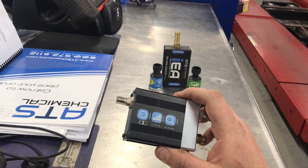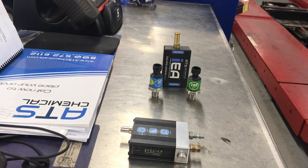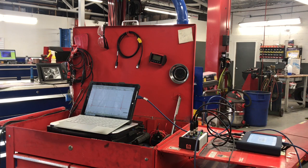The WPS500 is a very good sensor — it has three sensors built into one. The problem with that is when you're doing engine analysis you need to overlay all three pressure waveforms at the same time, and you would need three WPS500s to do that. The nice thing about the Pressure Pro from Automotive Test Solutions is that it allows you to overlay all three sensors at the same time for about the same price as one WPS500 kit. Now let's take a look at the Pressure Pro in use.